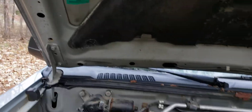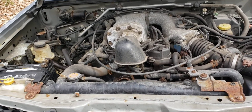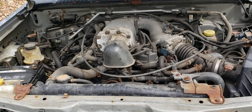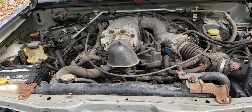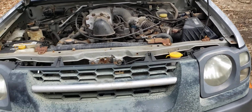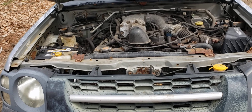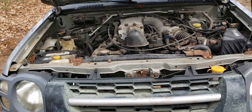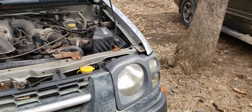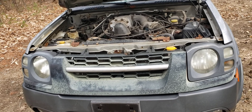There are a few differences: the supercharged version has a bypass solenoid to operate the bypass valve. You can get away with blocking it off and running without it — allegedly it won't cause engine damage — but it's not suggested. What the bypass valve does is, when you're not in a boost situation, it opens to bypass the blower so you have little to no boost in the intake. This gives you better fuel economy because the motor isn't constantly fighting the blower. With it hooked up, the engine runs a lot smoother. Without it, especially with a stick shift, it'll bounce around a bit.